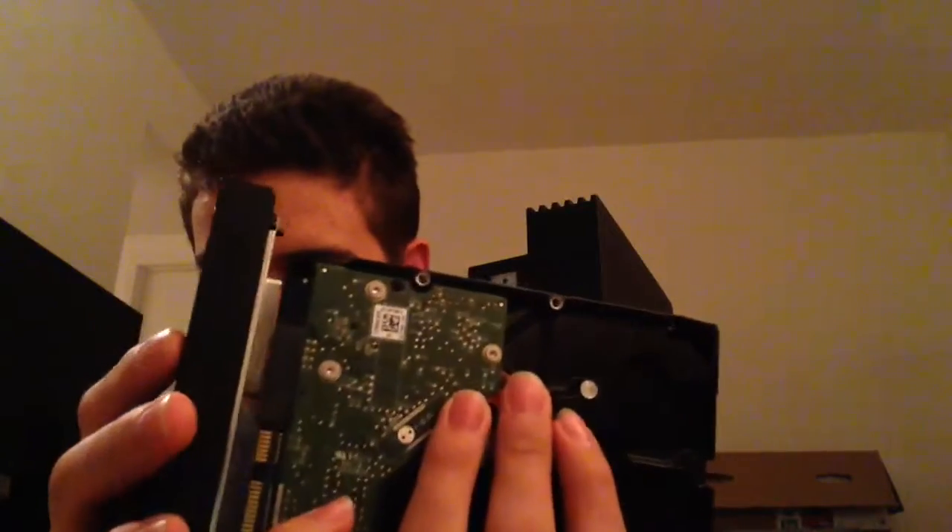Now, I'm sure I remember from that unboxing video that I did the other day that this piece was missing. Just connect it like this on the SATA ports, and then press it. It should be like that. Face these things up and push it in like this. Make sure all the pins line up correctly, so that way it can be all snug inside.